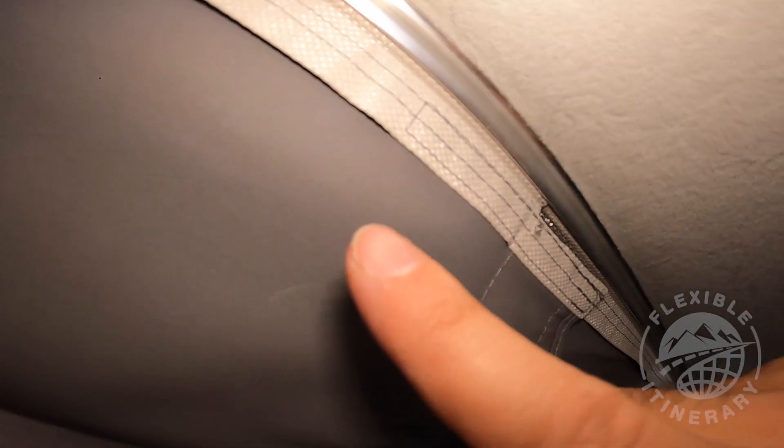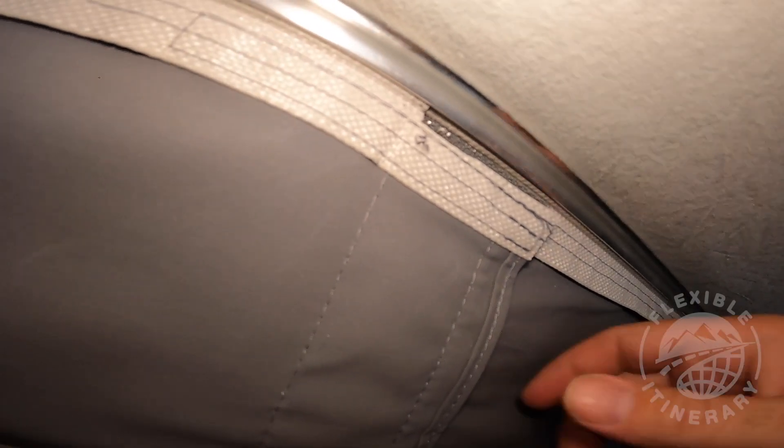All the way in the back, the rearmost panel has only one snap in the middle, and it comes together where the canvas flap overlaps — so there are three layers of stitching rather than two. Using some common sense and guesswork, I centered the hole in line with the top two and in between them. You are drilling through a couple of layers of hook-and-loop plus the tail seam, so you'll pull some fluff through from the velcro.